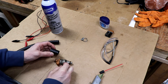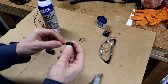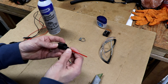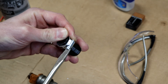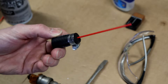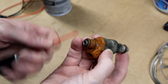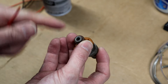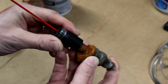It doesn't have to be very long. Here I have a little rubber stopper — all I've done was drilled a little hole in it, and the straw from my cleaner I stuck through it. It's going to stop right at the end there. We're going to put that into our fuel line. Now it seems like it would be easier just to put a straw directly into the injector, but the way these are designed there's a little tab on the inside, so you can't stick anything in there. That's why you have to put fuel line on the outside of it.